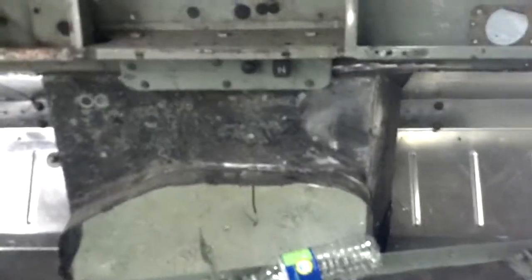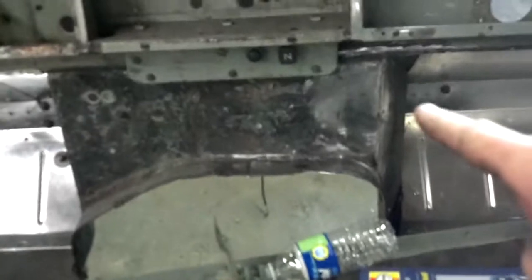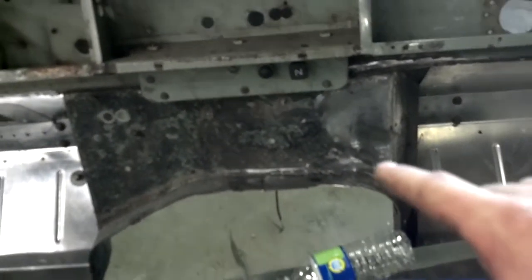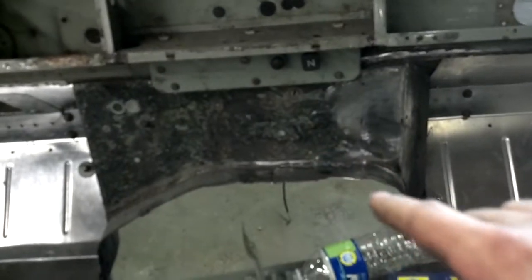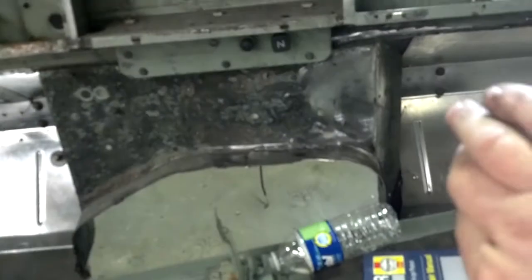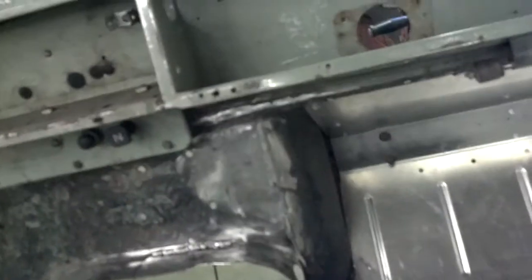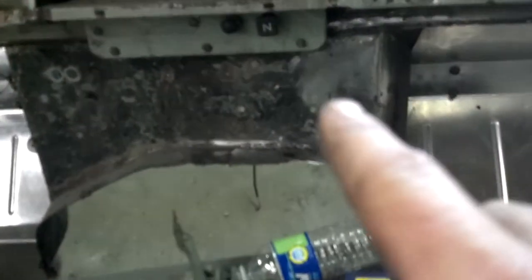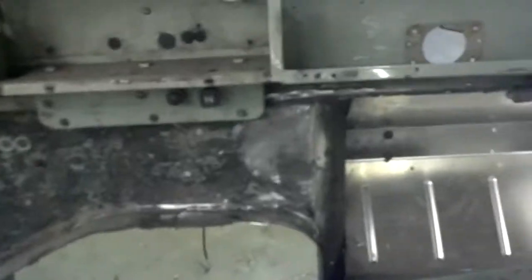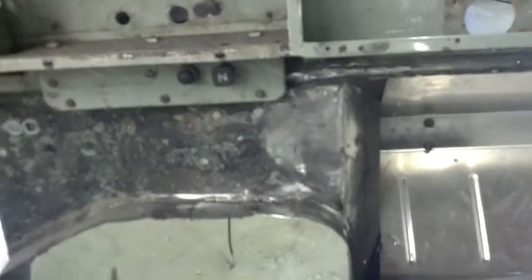The larger engine assembly and bell housing requires that you go three inches wider. If you look closely here, we made a very careful incision, cut up and over, then removed about a three inch section and pushed it over three inches, letting it lap behind. That left us with a three inch gap, so there's a three inch piece of metal here, and that little chunk went there. I think we've done a fairly good job of getting that pretty.